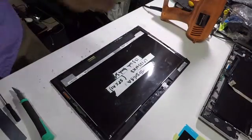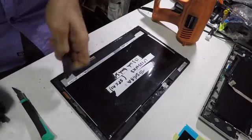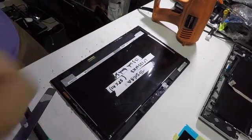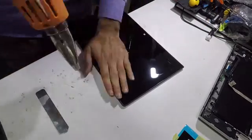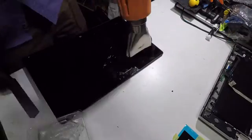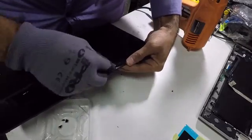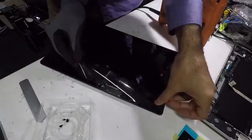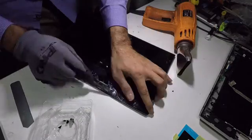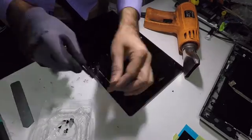So we need to use our heat gun and any tools you may have to help you with this project. Good luck — I'm going to speed up the next process. I do recommend you wear two sets of gloves instead of one. Toshiba has used a lot of glue, so just go bit by bit. Don't apply too much heat or you will melt the plastic holding the LCD together — if you do melt it, you're pretty much screwed, because it will be out of shape and you can't put it back together again.